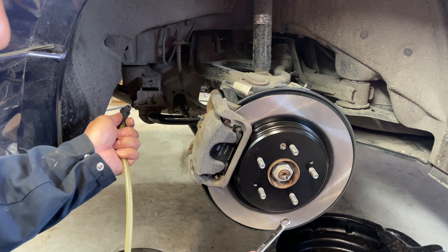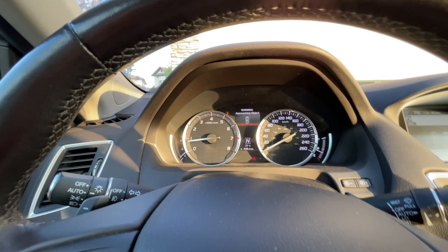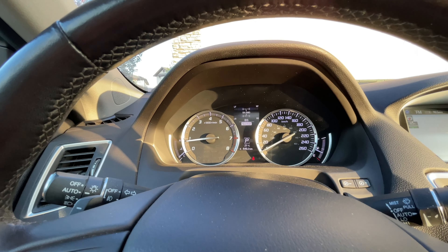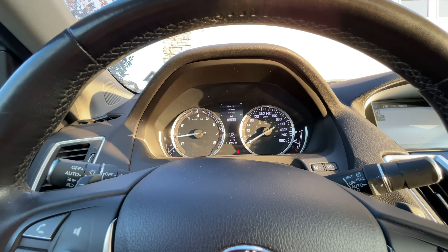With the parking brake activated and the vehicle in neutral, the car is not rolling back — it's even telling us to shift to park. Release the parking brake while holding the brake pedal and the car should roll back, confirming the parking brake is functioning correctly. Put it back in park — that is all there is to it. If you guys liked this video, give it a thumbs up and consider subscribing to the channel.